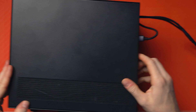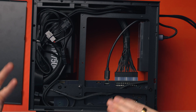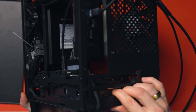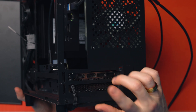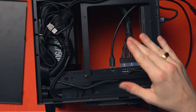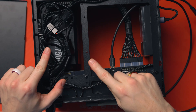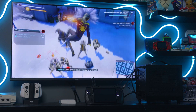This is the back of the build — a bit of a mess, but I've tried to cable manage it as best I can. From the front it looks fine. I've got all my fan cables here — that fan on the bottom comes through the back slots, where you'd normally have your graphics card, up through the grille and tucks around the back and inside. To connect the fans I've used Molex-to-fan connectors, so the fans plug directly into the power supply and run at full speed at all times — around 1500 RPM.